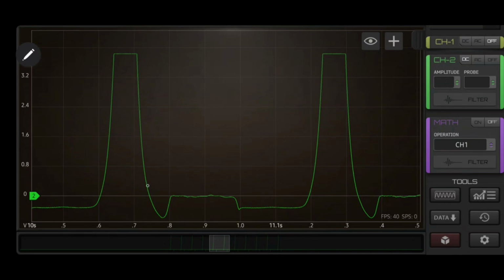Now our exhaust pockets here are actually looking semi decent in this, but yet again, our exhaust pocket is lower than our intake, and that should not happen. So we definitely have an issue here with the intake valve opening too late, which is causing us not to get enough vacuum. And you see how this vacuum line comes down, and we see that hook in it before it comes back up. That sudden change. So that shape is actually off, which is also indicative of an issue.